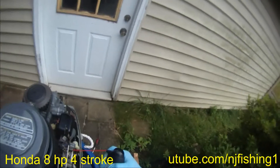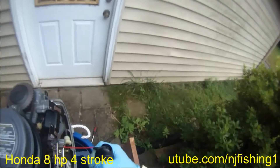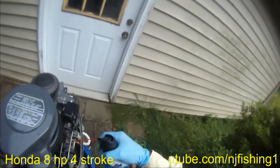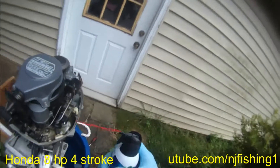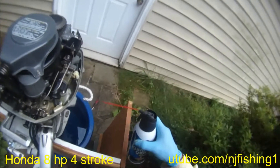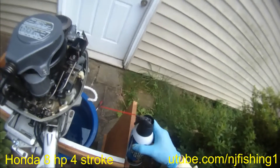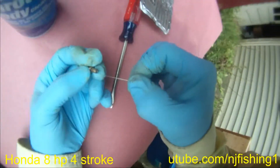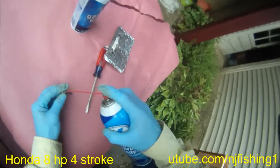Same thing here — clean out the carburetor more. I think that's about it. What I'm going to do is take care of those two screw holes using some very thin metal needles — actually acupuncture needles — to clean out those two holes. First I'm going to spray carb cleaner in there.